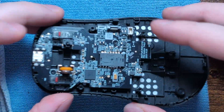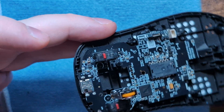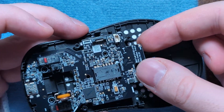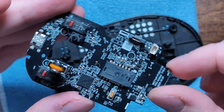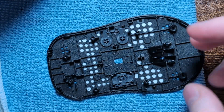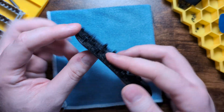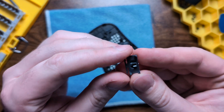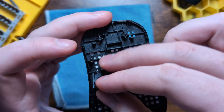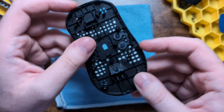With the top cage part out of the way, let's talk about removing the main board - this is actually pretty easy. All we have to do is remove a screw from here and two screws up at the top here and here. With those removed, peel the board up from the back and gently lift the main board off the base. For the base itself, there isn't much else to take off aside from the slider button, which may come off. If it does, remount it with the small piece facing outward so it slots back in.